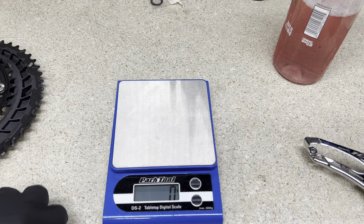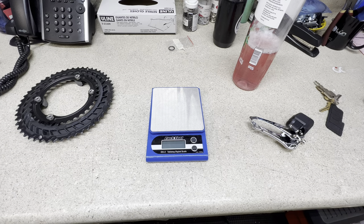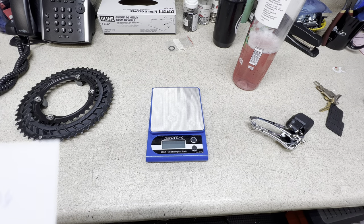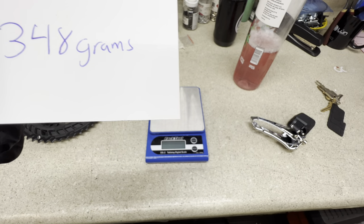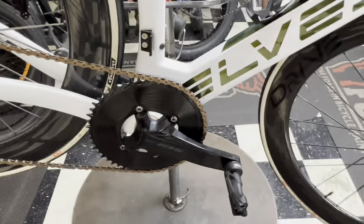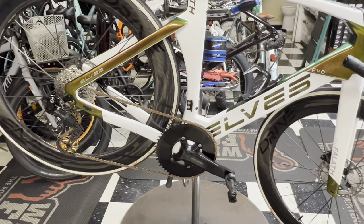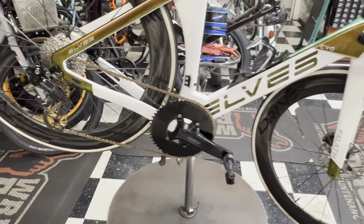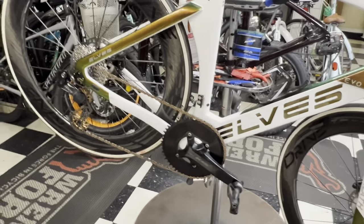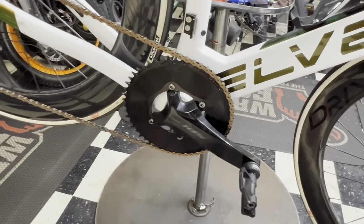Just for video's sake, I do have the exact same Di2 wire that's in my bike — an 850mm length wire — and that's 7 grams. So let's total that up: that is a total of 348 grams of takeoff from my bike. Now we're going to remove this chainring off my bike, weigh it on the scale, and subtract that to find out the total weight savings. 348 grams is about three-quarters of a pound. People do pay thousands of dollars to remove that kind of weight off their bike, and we're getting here with just an upgrade of chainring and a more efficient drivetrain.